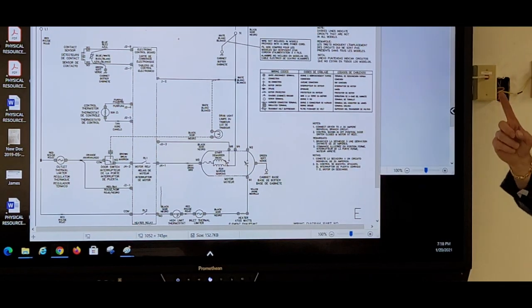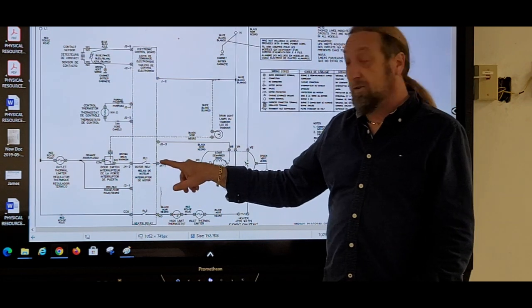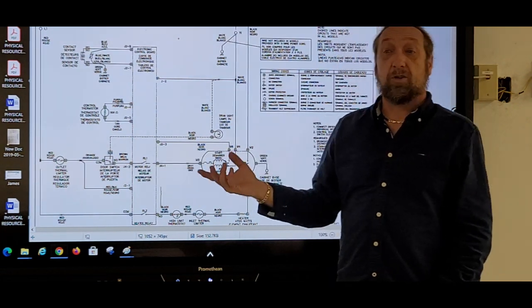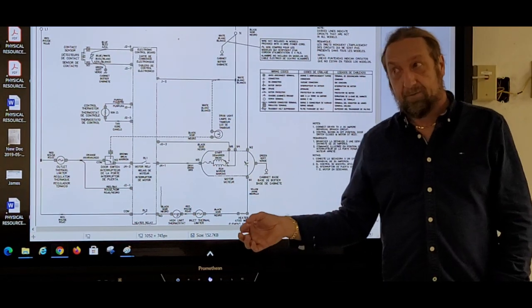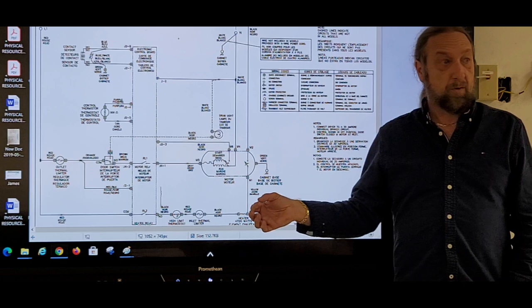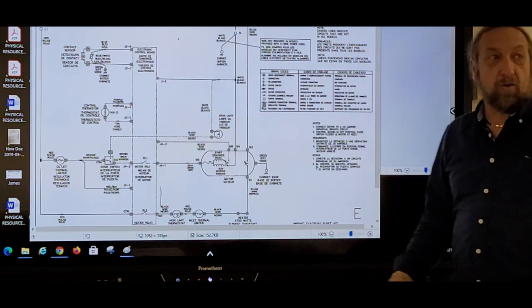Without pressing start. Because the moment you press start, this relay is supposed to close. Now it all becomes line one. Your meter won't read it. This is with the dryer off. Okay? But Willie, your dryer ain't working. These are things you do to test your dryer.